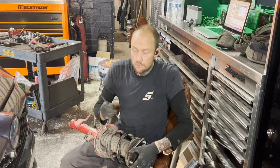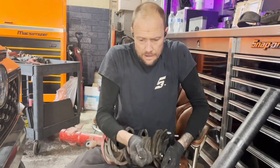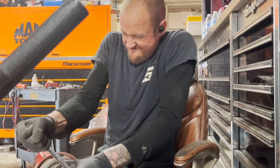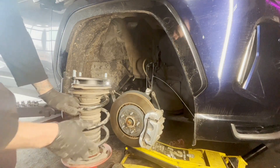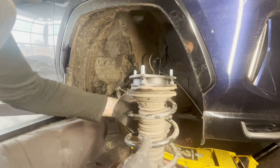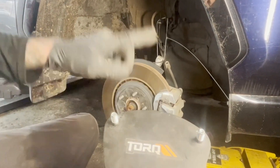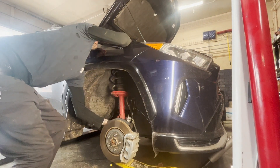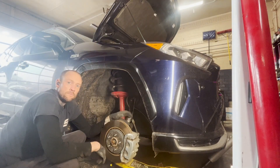In case you missed it the last time — when you go to torque these down, this is a very special torque sequence, and it may be uncomfortable for some people. Get it tight. You know you get it when your face looks like — you're really straining. So that one's torqued. Go to the next one. And the back one — that one really makes you work. If there's any confusion about which way it goes in, the notch that was on top is going to point towards the engine area. Once you get it up there, use one hand to hold it, come up top with the other hand and get your nuts started. Once you have one started, it'll stay there and you can get up and look at the other two.